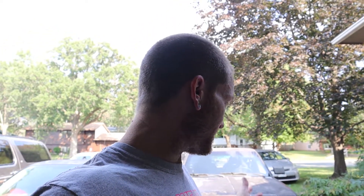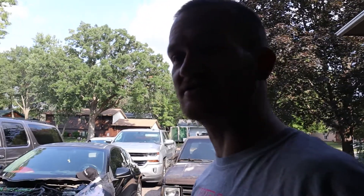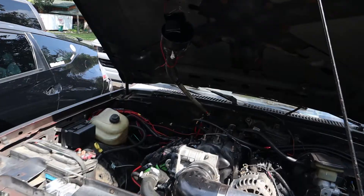If you're like me with a 6 liter and now a 4L80, you can just grab a 2005 Chevy 2500 tune with the 6 liter and 4L80. However, it's not as simple as just writing a calibration — you have to write the entire thing. Put your battery on a charger, or use a bench tuning harness like I have, because it takes about five minutes. If your battery dies during the write, it will brick your ECU — fair warning.